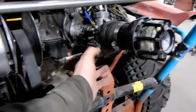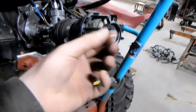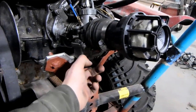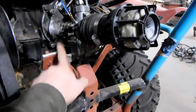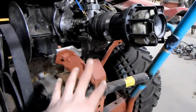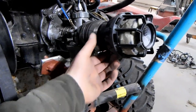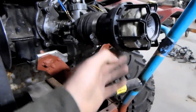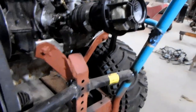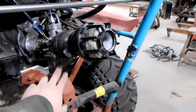I got the carburetor all in there, I got the air filter on there, I made an air filter element and oiled it up, as you can see. So that's good to go. At some point I'll have to take the carburetor back off and shave this motor mounting plate a little bit — it's probably because it's mounted freely as opposed to being attached. In the snowmobile there would normally be a big air box that would pull the engine up off of that, but the way it's on there now it just touches this, so I should grind some of that down so it doesn't rub, because eventually it'll spring a leak in this bowl.